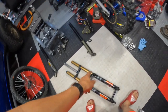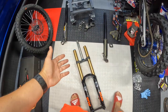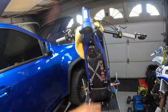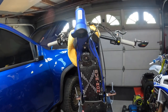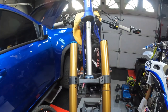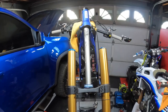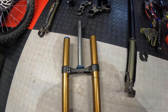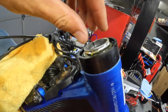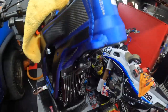I totally forgot that we don't need that race I greased up earlier, because we already have one installed in here. The 2022 comes with a tapered bearing, not like the older ones that came with ball or needle bearings — I remember reading about it on the forums where people recommended the Luna Cycle version. This is the OEM setup, so this will just pop right in there. I'll also add these: the brake line holder, the bump stop, and I'll check the grease up top. I like to pack these a little heavy — anything extra ends up on the outskirts and you can wipe it off with a rag after install. I'd rather have dirt stop out here than get in there and wreak havoc on your bearings.